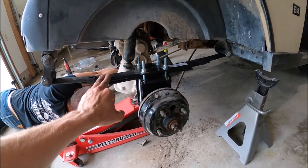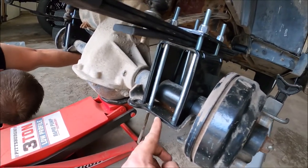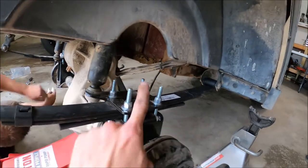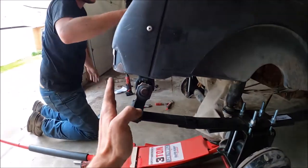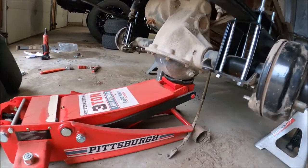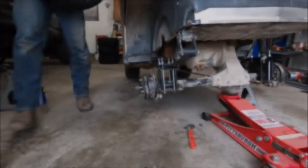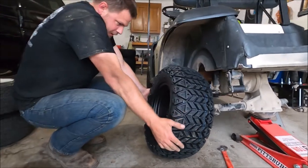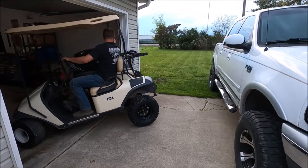I'm putting this plate right in here, then the leaf spring is going to sandwich down — there's a little bolt hole that goes through this hole here — and then I put this plate back on top and sandwich all of this together with four bolts. The shock goes through this hole in the front. So that's the back install: the original axle mount, put the block in, put the leaf spring up, new plate that clamps it all together, new bolts, old shock back in, and now we're just putting on the brake lines and wheels.